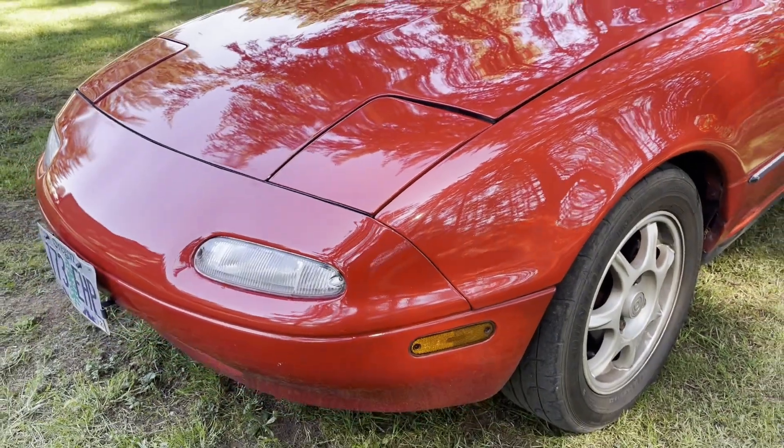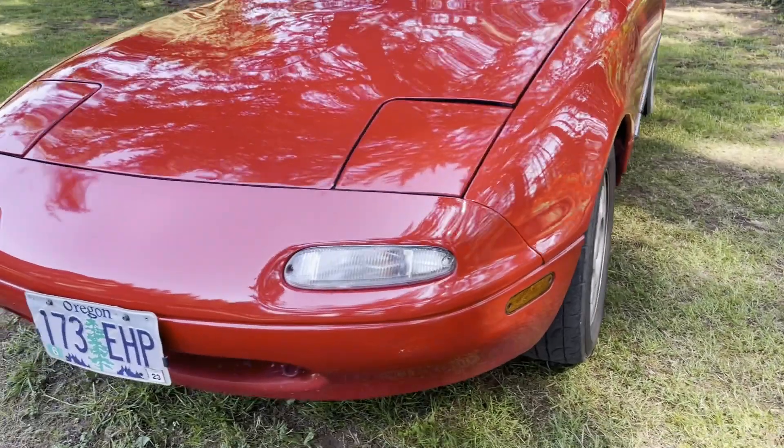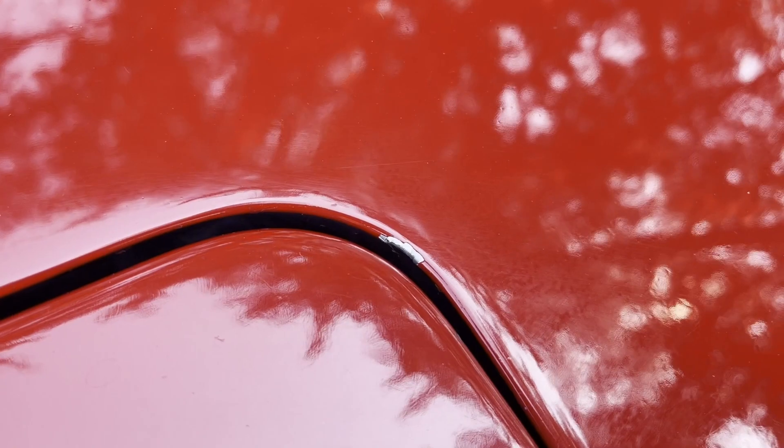I did replace the headlight buckets, the front bumper, and the hood. The only places where there's any adhesion failure are two little spots right on the inside edge of the hood — there's a little chip where you can see the silver — and then one over on the inside edge of the other bucket. I think this was lack of prep rather than a paint materials failure. You can see on that inside edge around the headlight bucket where the chip is that it could use some buffing out.